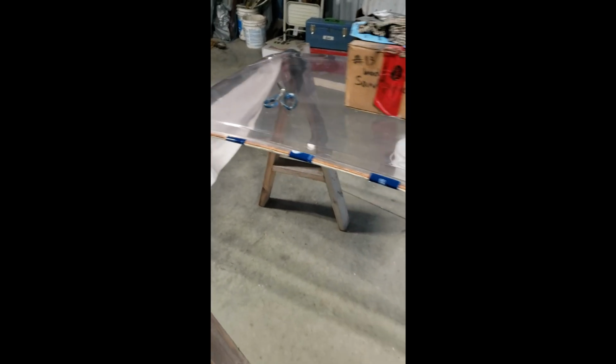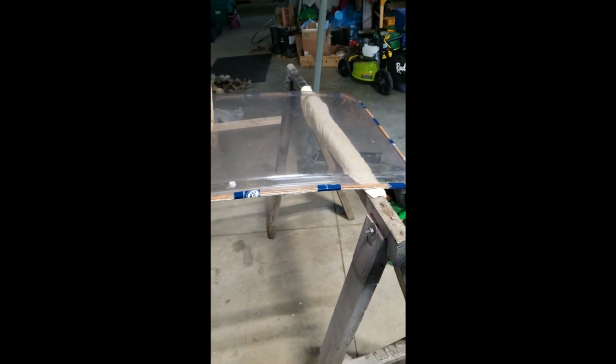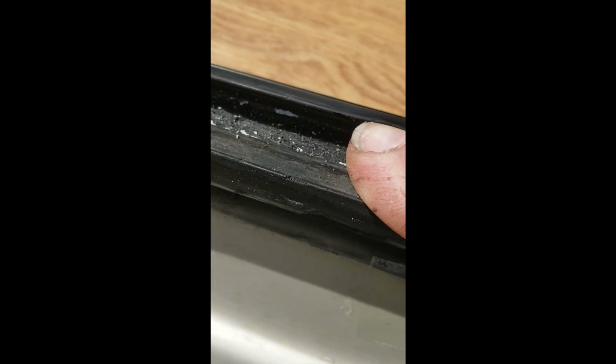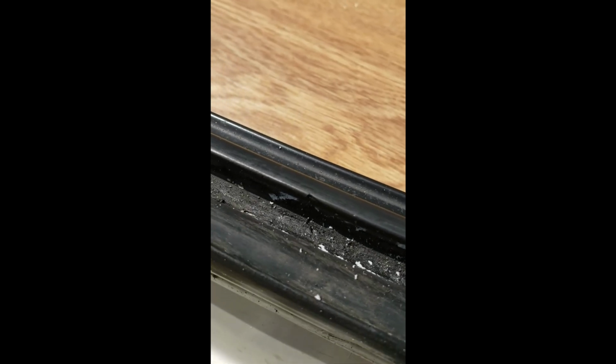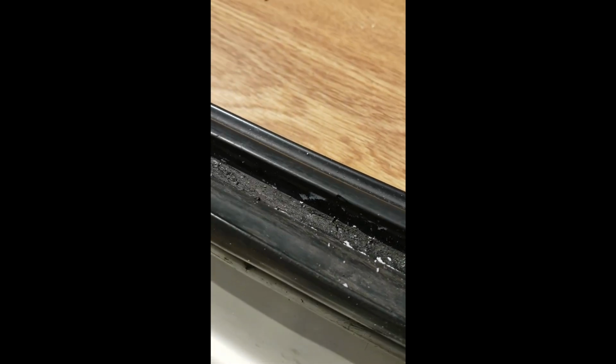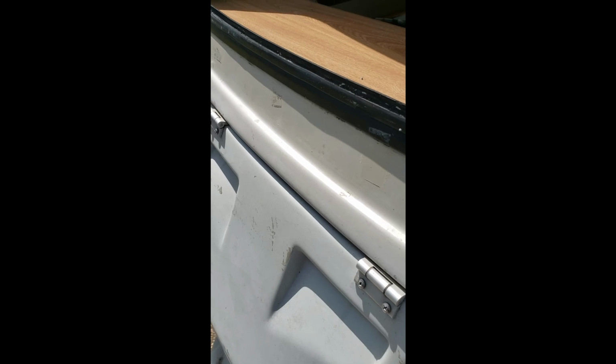There is a Ward trailer window ready to go back in. There's Sikaflex all the way around, except for this stretch, just so I could show you how deep I put it. This groove is a little more than 1/4 of an inch wide, and I filled it to roughly 1/4 inch deep, a little bit less than that. So I'll finish filling it and slide the window in. This is all hooked down except in the corners, so I'm hoping that'll work. Here goes. It's a one-shot deal.